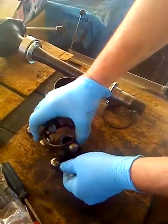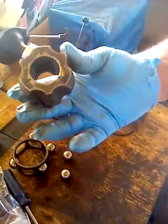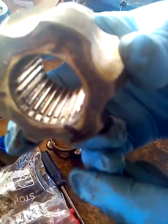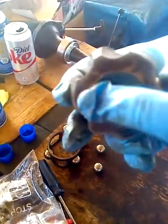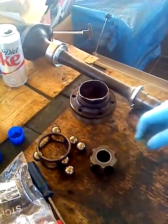Something I want to point out is that this inner race has an upside and a low side. On the inside, you'll see that there's a short spline. This short spline needs to point towards the transmission. I've marked this with a T. When you do this assembly, you just put this with the T down.